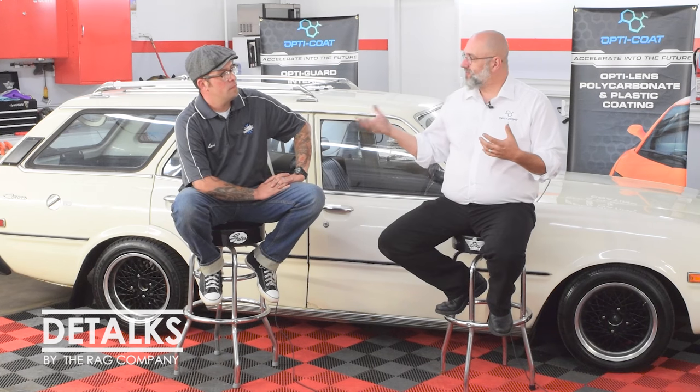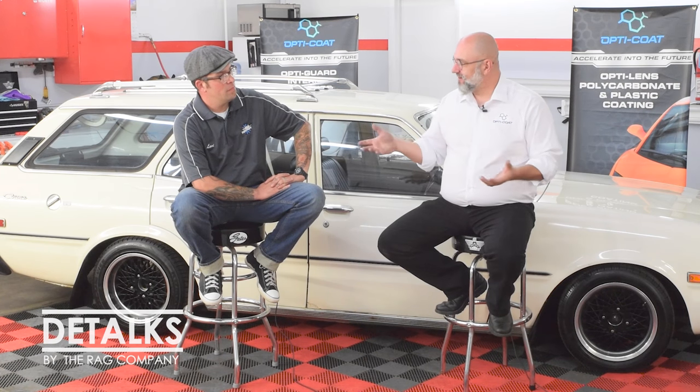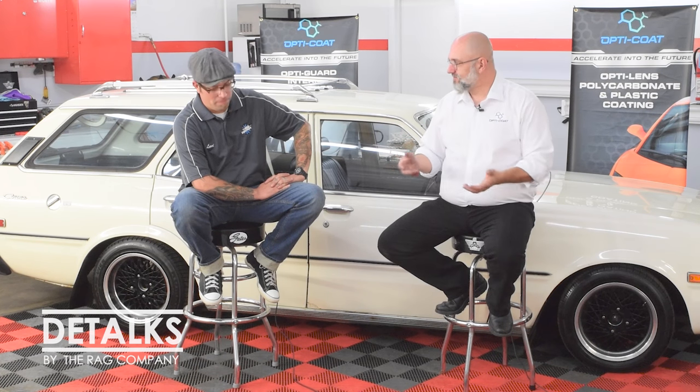And a lot of people, I've seen, read this online, say that they're reflowing the paint. That was a common term I heard too, growing up through it: you've got to get it hot enough, you've got to get it to reflow and pull it over those scratches. That's what they would say. And I was like, that doesn't work. We're rounding edges. We're not pulling clear to bring it down.